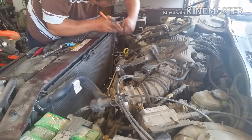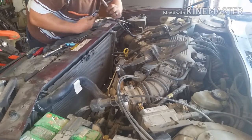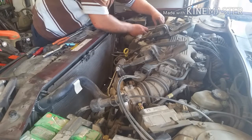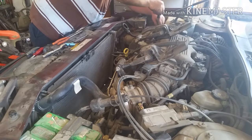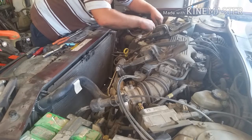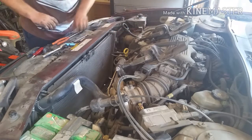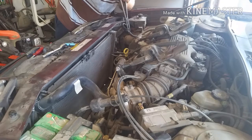And you gotta take your upper hose off too. Okay. Oh, you already disconnected that. Okay. Which actually, this might be easier. Stupid clips that they got. You just disconnect the line from your reservoir. Plastic. Yeah, be careful you don't break it. Just a little plastic. Or if you can turn the hose. I am able to. And just grab the two little prongs on one side. That's the pain in the ass part.